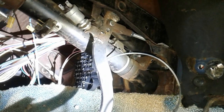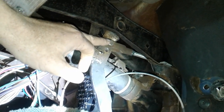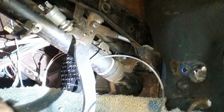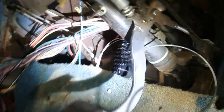In the instruction sheets with these brake kits — this one is from Speedway, but they're all the same whether you get it from Summit, Speedway, or any particular company. What needs to happen is: manual brakes have a hole up here because they need leverage, so they need a longer bar from here to the pedal. Disc brakes use more fluid going into the calipers and need more stroke. With power assist you don't need leverage anymore, so you need to drill a new hole about an inch down from the original hole.